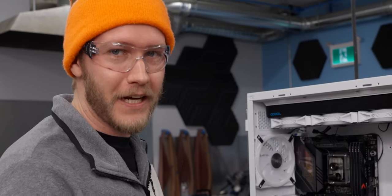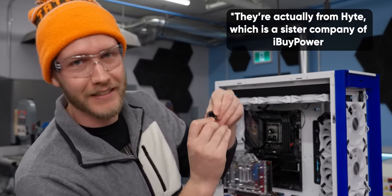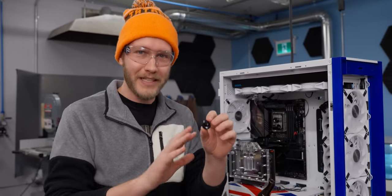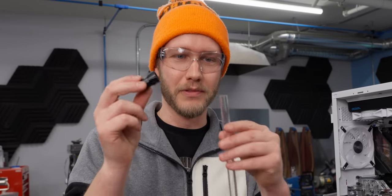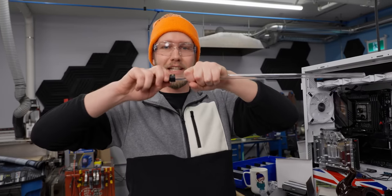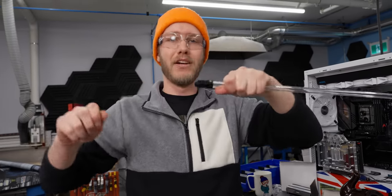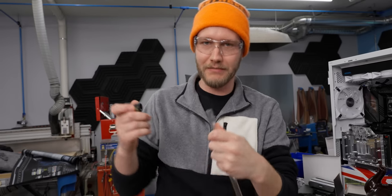One other very fun thing about this build are these fittings from iBuyPower — little SharkBite fittings. These are prototypes that don't exist yet, but maybe if you guys like them they'll start actually producing. In my testing these things work really well — you can just push it on, and I can pull on this so hard and it does not want to come off. But then you just push the fitting in a little bit, SharkBite comes undone, and boom. We'll be doing hard line water cooling: cut a piece of tube that's a bit too long, stick a noodley boy in the center so it doesn't warp, heat gun, bend it, sand it down to size.